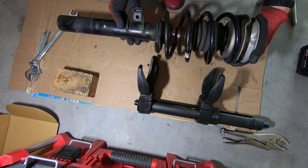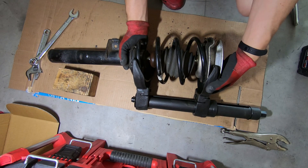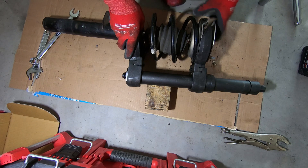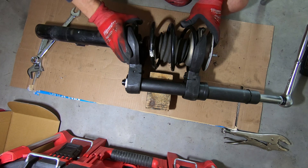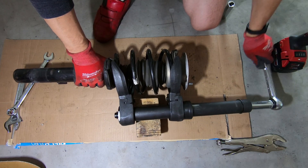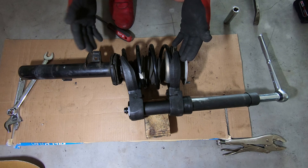So I need to compress the spring. This is the way I figured it can be done. This lower part gets right here, and the upper one grabs on the upper seat. This demonstrates that the spring is not really loading the strut anymore.